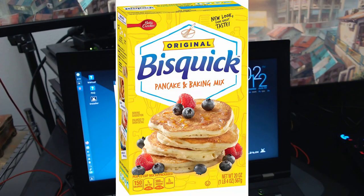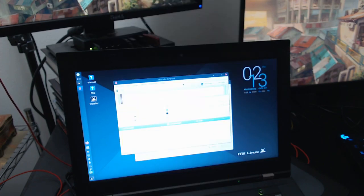So I know BizQuick did a video about installing Linux, and he said, well, Windows doesn't work. We're just going to erase it. You don't have to do that. You can actually do the startup repair, and it will fix that, and you will be able to boot to Windows and Linux. In general, if you're getting that far, all you really need to do is run the startup repair on Windows, and it should allow you to boot back into Windows.